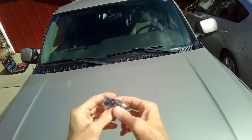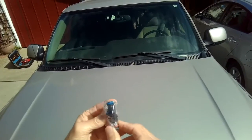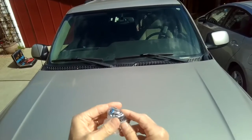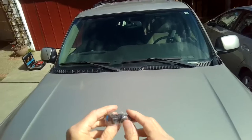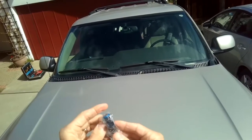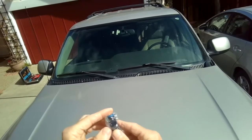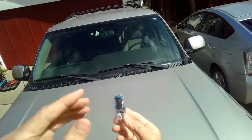Before you put a new injector in, think about adding fuel system cleaner into your gas tank, because it's really inexpensive and easy, and a lot of times it'll cure the problem, it'll clean the injector. But if you don't, you can always buy just one injector to fix the problem, or you could replace them all. They're really expensive though. They go for about $50 to $60.